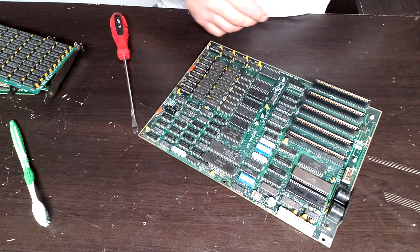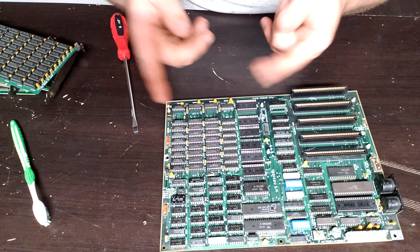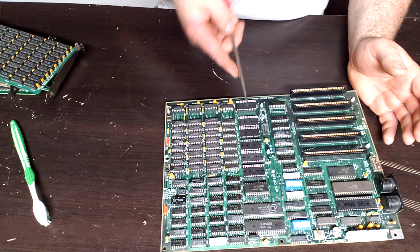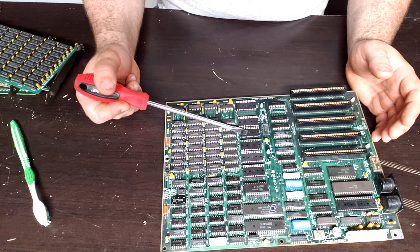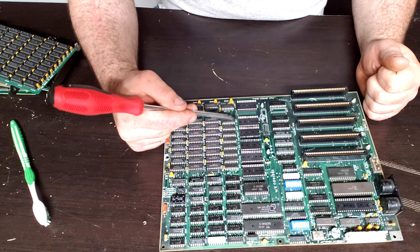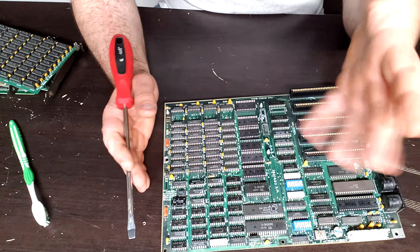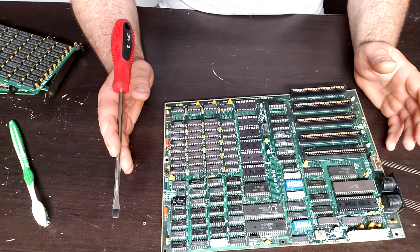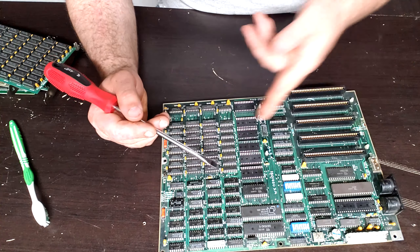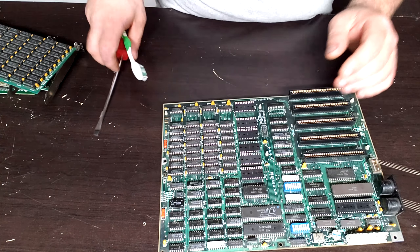One looks fully clean. Let's scrub the crap out of these, let them dry, and then I may need to grab the dead 5150 board to show what's wrong with it. I've already started taking those chips off that board. If I need to, I can desolder one of the sockets on that board and see if it works. I think these five chips are just the basic ROMs — the machine might still boot without them, but I don't want anything mucking up diagnostics. I'm going to clean these up, test them, and go from there.